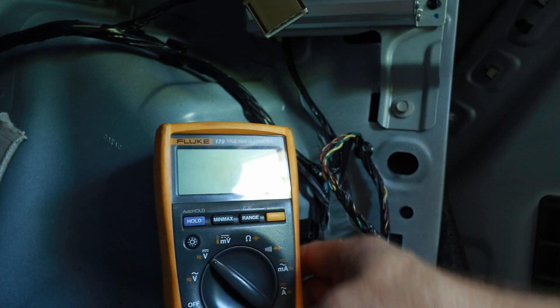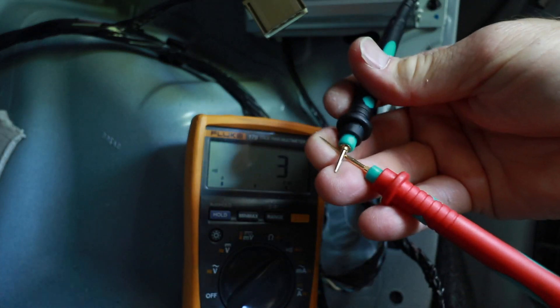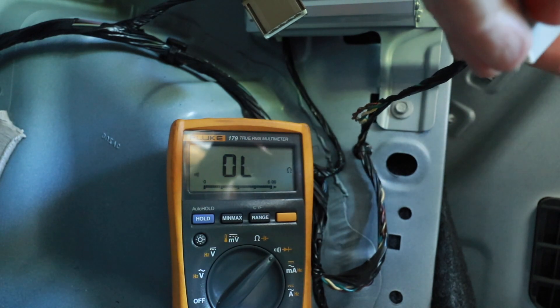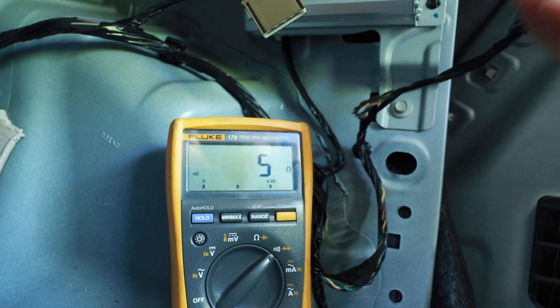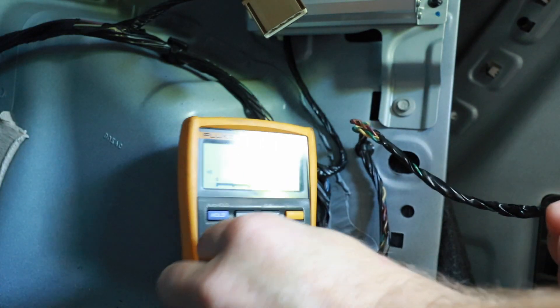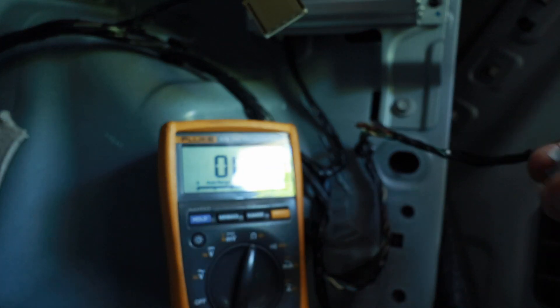I can test that with my digital multimeter. First, we'll try continuity - where I take my two test leads and when they touch they make a sound. I'll put one into the brown wire with a white stripe here and grab the brown wire with a white stripe over in the factory plug, and I get continuity. I can move to the next wire and get continuity as well. If I can't get to the speaker, I can do a resistance or ohm load test and see if it looks like a speaker - looking for something like four or two ohm. Getting about a four ohm load there. So this tells me these are indeed the speaker wires, and the factory subwoofer is around four ohms.